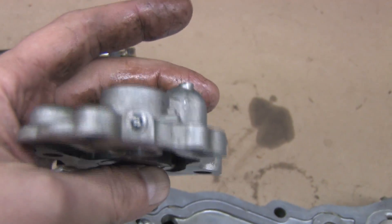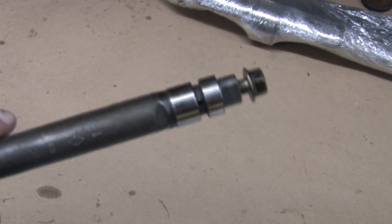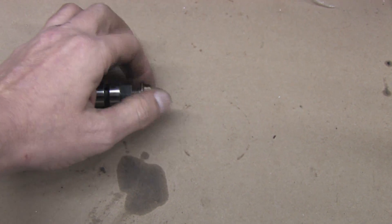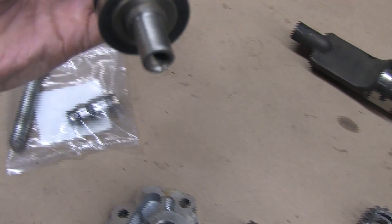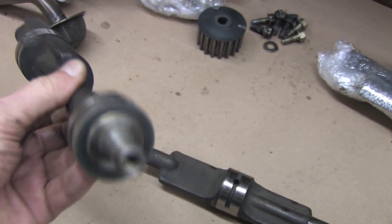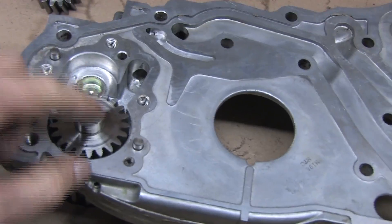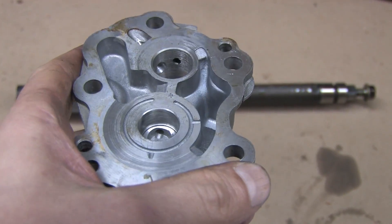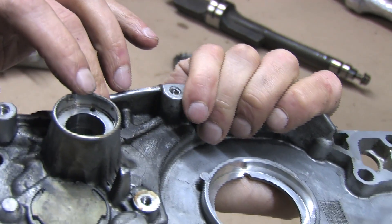From this short gallery on the front case, oil passes through intersecting holes that eventually meet up on the pump's rear housing. There's an oil gallery drilled all the way through it and staked with a plug on one end — this supplies the oil pump driven gear's shaft bearing surface with oil. The balance shaft has a groove on it with a cross-drilled hole through it, and this is where the balance shaft receives its oil supply for the solid bearing inside the block — a bearing with no oil holes. The bolt on the end of the shaft serves as a plug because that's where they drilled from to create the hollow gallery. The front shaft's oil supplies are tapped directly off the block's main oil gallery, but on the back, the oil pump shaft is hollow and third in line for an oil supply. Fourth in line is the oil pump drive gear running off the timing belt, and last in line to receive fresh oil. Whatever oil is left over bleeds off into the pan through this little return hole.